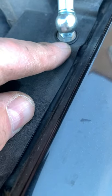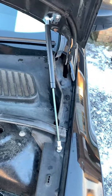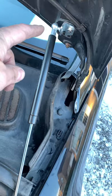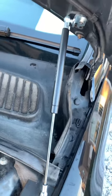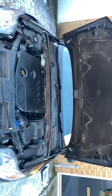Make sure to put the washer underneath when you attach the strut. Top tip: fit this one first on the bonnet side, because you can't get the clip that secures it — to stop it popping off — back into the little holes if you put it on the wing side first. Once they're done, voila, finished.